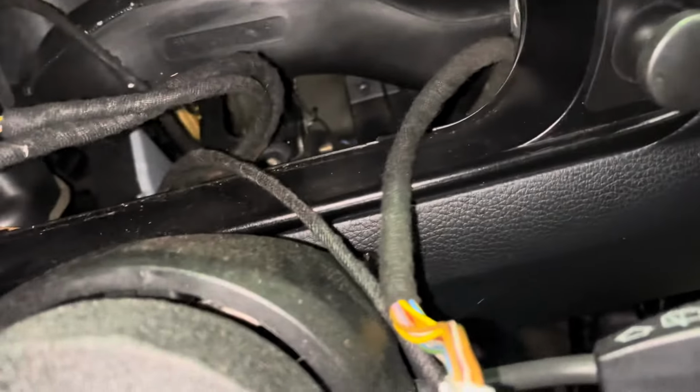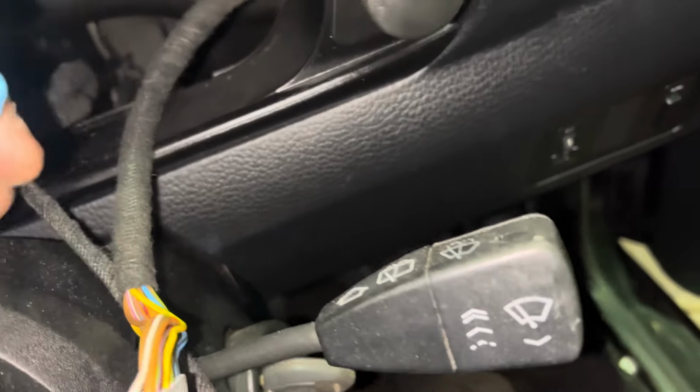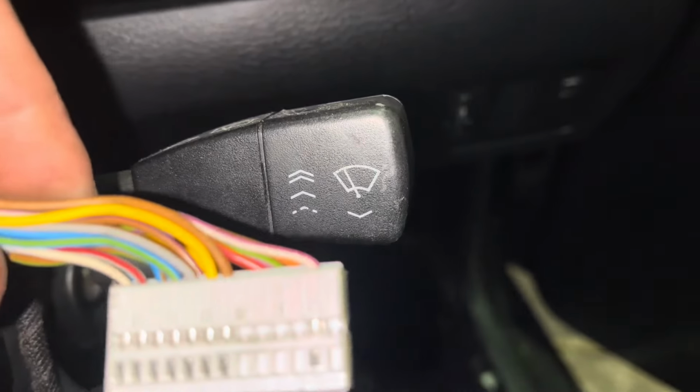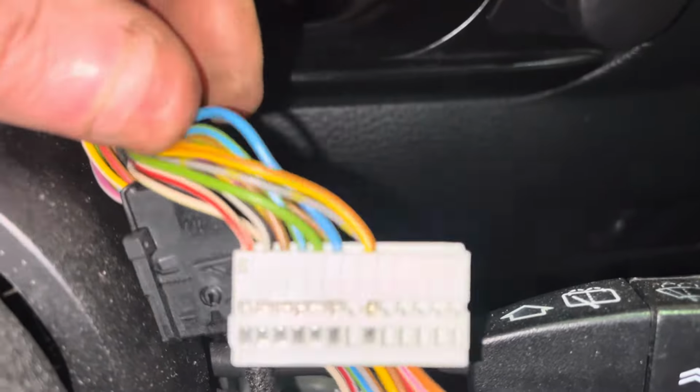And what I've just realised there is, when I've come to do this one, it has the speed signal. In fact, it's actually this one. Speed signal on pin 2. Is it, where are we? Pin, that's not that one, it's this one. Pin 2 has the black and white wire there for speed signal, the second one in, right? But to save me untaping all this wire to get a bit of wire, I'm just going to pull pin 2 out of there and put my pin 2 in, so I've got a nice bit of wire, but it's just to save untaping that part of the loom.